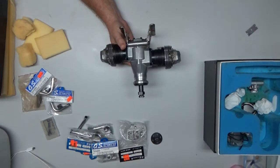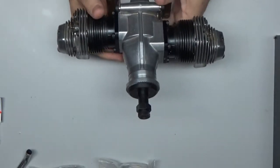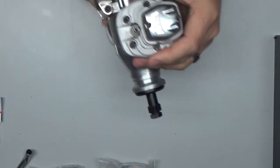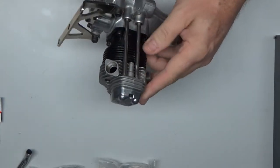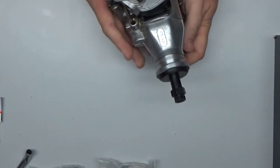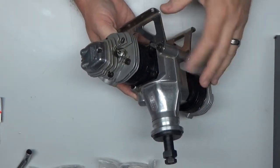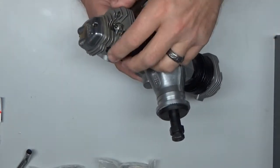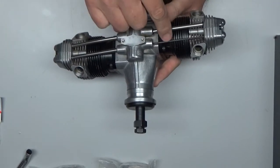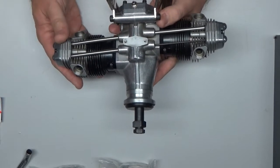So this is the FT-300. The left side of the engine looks fine. This thing is heavy. Here's the right side — this is where we've got some damage. It looks like as it was coming in, it went this way and sheared some of the cooling fins off. One of the pushrod tubes was also damaged. The carb and intake manifold assembly have been taken off this engine.